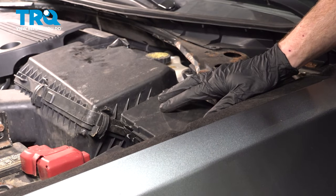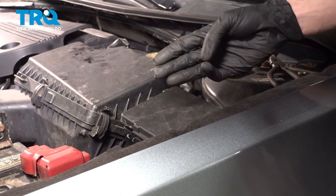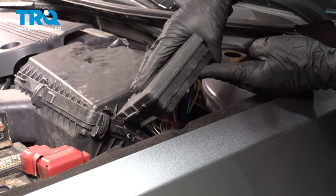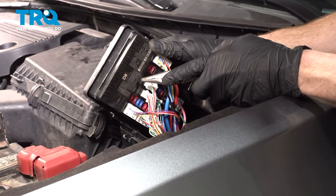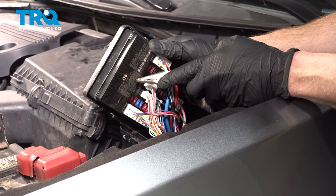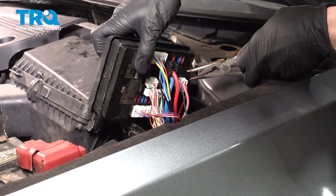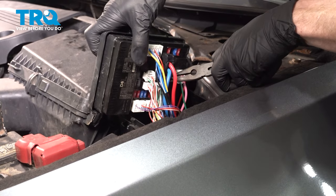Under the hood, we're looking along the driver's side of our air filter box. You're going to find a rectangular housing here — it has four locking clips. Just carefully press those away and then you should be able to lift it up. As you lift this up, keep in mind there is wiring under the area. We do have to look for the legend. Looking down under this area, we're looking at all the different fuses. I'm looking for the fuel pump fuse — it's a 15 amp and it's right in between all of these 10 amp fuses. You really can't mix it up. We'll continue on to removing that one 15 amp fuse. When you do so, you want to be extremely careful not to be grounding out against anything while you remove it.